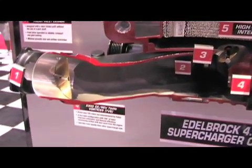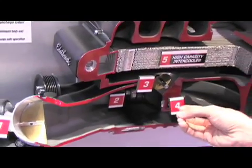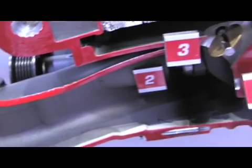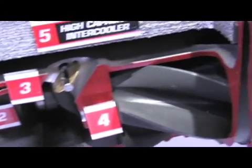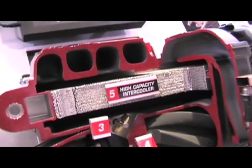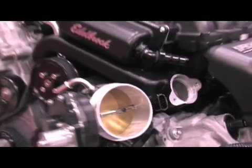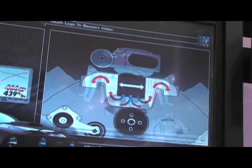You'll notice it's a unique inlet and drive system in the front — we call this the front inlet front drive system. This allows us to both drive the system and intake the air on the same side, the front side, which is most logical for packaging because your air box and belt drive are typically at the front of the car. You'll notice this nice straight inlet path here, which minimizes restriction into the supercharger, fills both rotors equally, and it starts with our 85 millimeter electronic throttle body, which is included in the kit — making sure the supercharger doesn't have to work any harder to pull the air in before it compresses the air in the plenum.